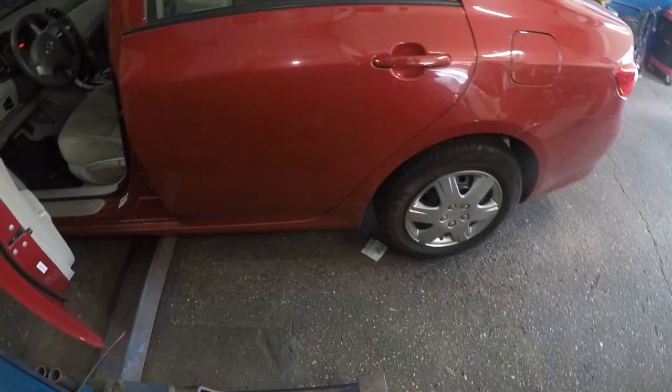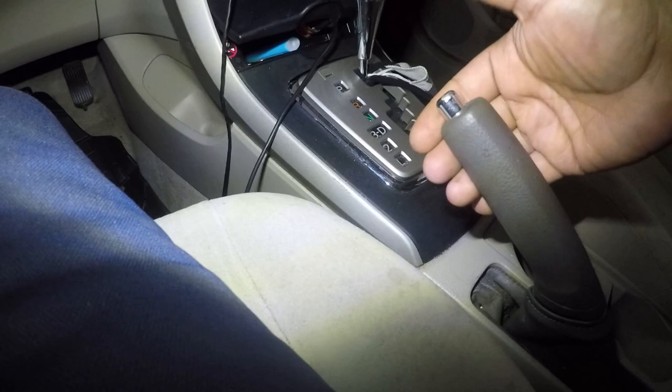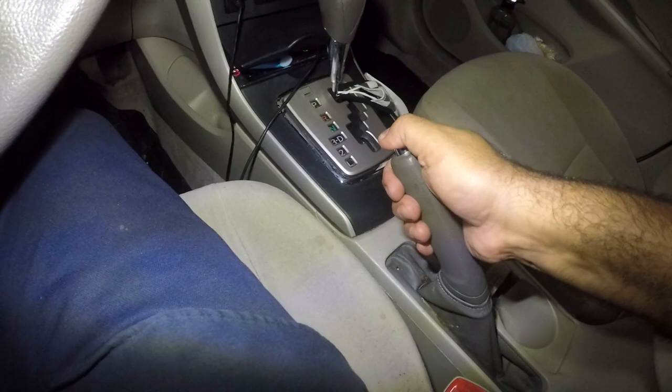I'm done with both sides. I just want to show you guys something I should have done this before — once you're done, your e-brake, check this out. You see that, it's tight. If your e-brake is going all the way up like that, this is the furthest I could get. If you do the adjustment like that, your e-brake should be much better — even your brake pedal will become much much better.